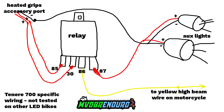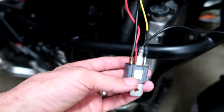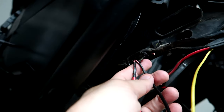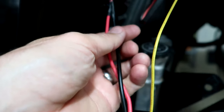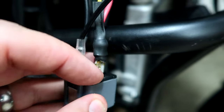Here's a rough wiring diagram. Your relay terminals: 85 and 30 both go to power — I've got them going to the accessory power on the heated grips circuit. Terminal 86 goes to the yellow wire, which is the trigger for the high beam. Terminal 87 goes to the positive on your LED lights or whatever. Then the negative from your lights needs to go to earth, or back to the negative on your heated grips circuit. Don't worry that one wire is black and one is red — both are going to the accessory positive, one on each terminal as mentioned.